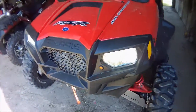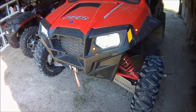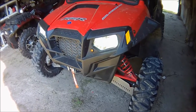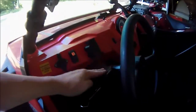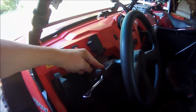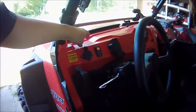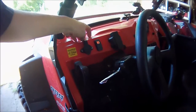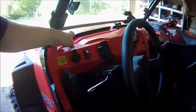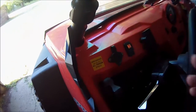I actually looked up a Razor overseas — some of them do come street legal with the parts already on them, but the kit was ridiculous, like $600 American. These little button lights here are $5.99 each, and this control head was $49, ordered from my local auto parts store. The control head comes with a flasher control, but the one it comes with is meant for incandescent lights — LEDs do not draw enough current to make it flash properly. So I also had to spend $22 on a separate flasher control. It looks kind of like a relay — it's what makes them flash.